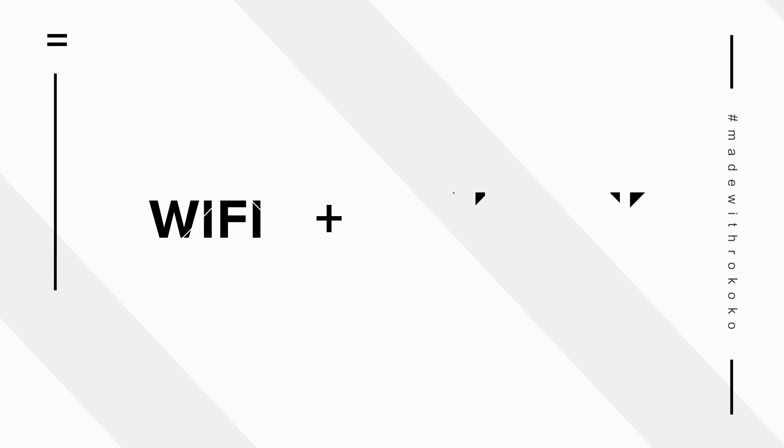For VTubing, what we recommend is to connect to your router both over Wi-Fi and hard-lined through an Ethernet cable. If you were to connect just over Wi-Fi, bandwidth would really start to become an issue, because not only are you sending your mocap data from your suit, your gloves, and your facial motion capture device over to your computer over Wi-Fi, you would also be sending your livestream output video over Wi-Fi up to YouTube or Twitch. By connecting over Ethernet, we can free up that Wi-Fi bandwidth for all of our motion capture data.